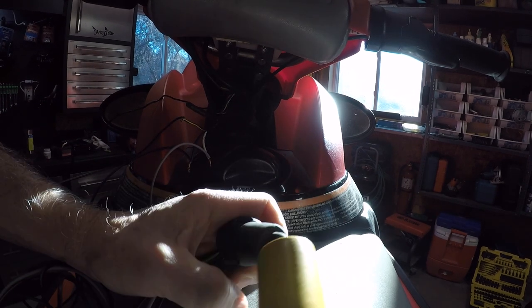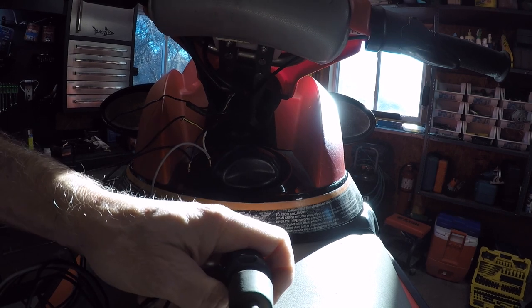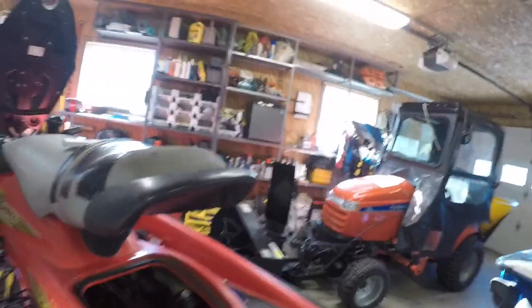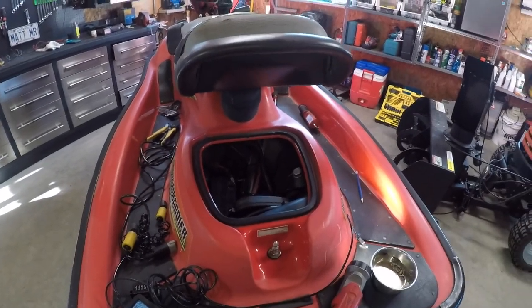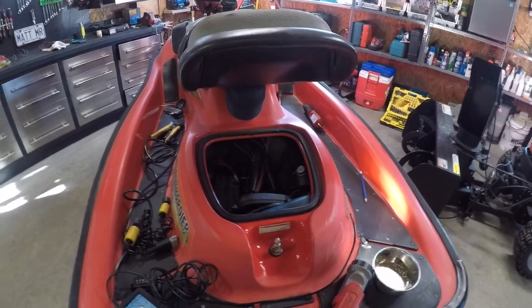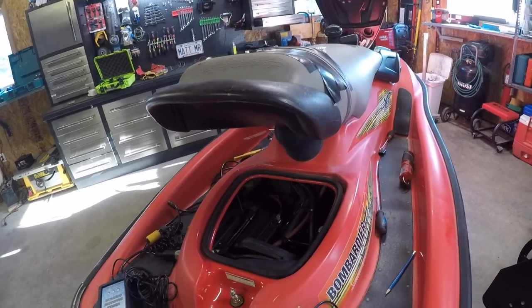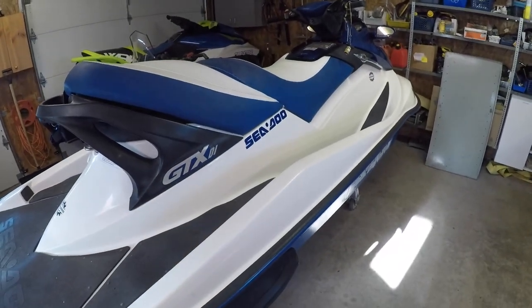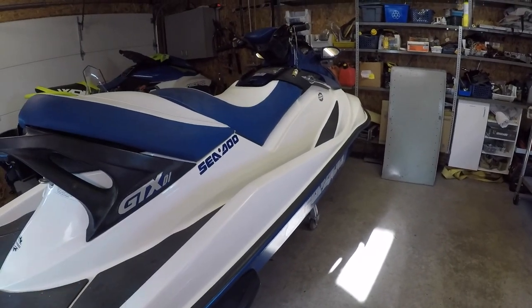Well, now we're in deep. All right. What's next? Okay, so not the tether. Then I started thinking we had 8 volts at the computer right at the very beginning when we first checked this out, and I was kind of suspicious of that. But then I thought, maybe more volts go in when you hook up the tether. Anyway, I hooked the power back up on the GTX, and sure enough, full 12 volts at the computer.